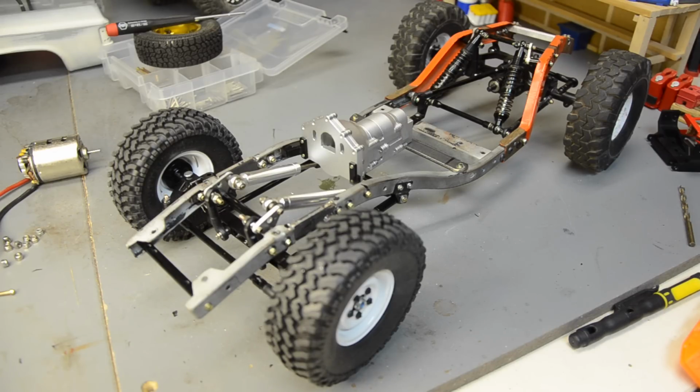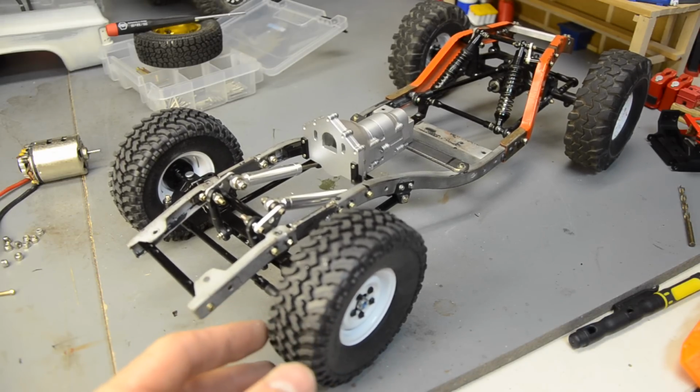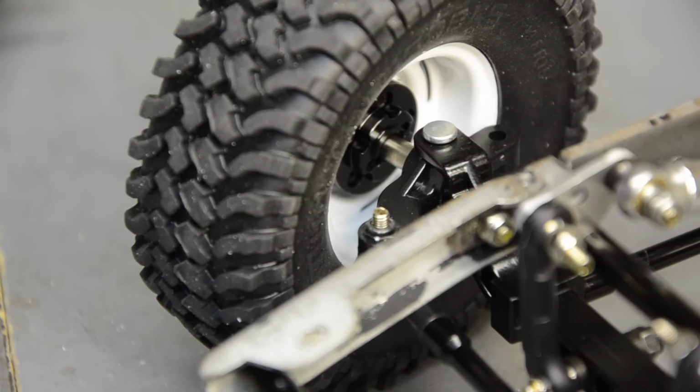And I've still got a lot of work to do with the hubs. I've got these front tires bolted on, but let me show you what my problem is. As you can see, I've got them just pushed on there. They still have the center hub for the drive axle with the pin, so they're just kind of sitting on there. I've tightened the lock nuts down enough to where they still spin, just to help me mock it up. So I've got to figure out a hub adapter or something. I know there's some bolt-in center hubs like that for the semi-trucks. I may actually have some. I'll have to do some digging around again. Hopefully I have some, because I don't want to spend any more money on this thing. But that's one hurdle we have to cross.